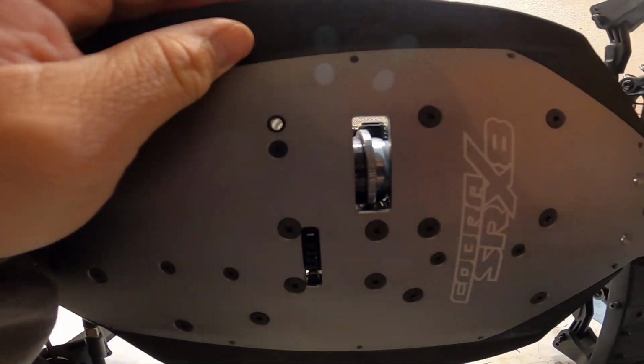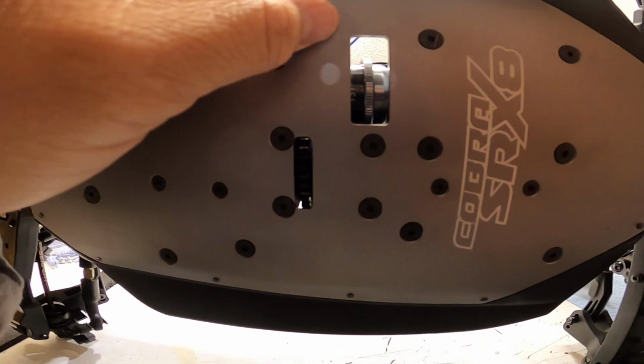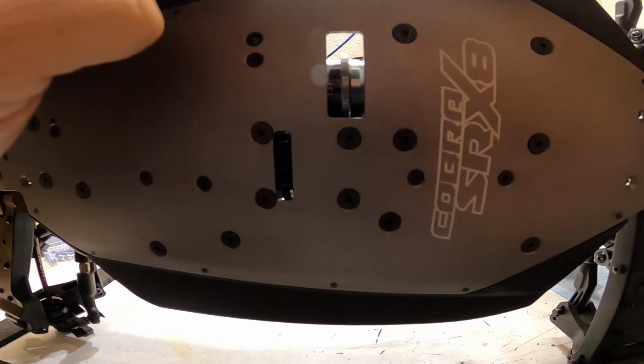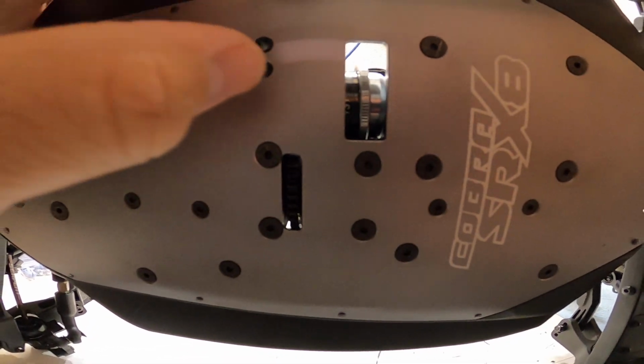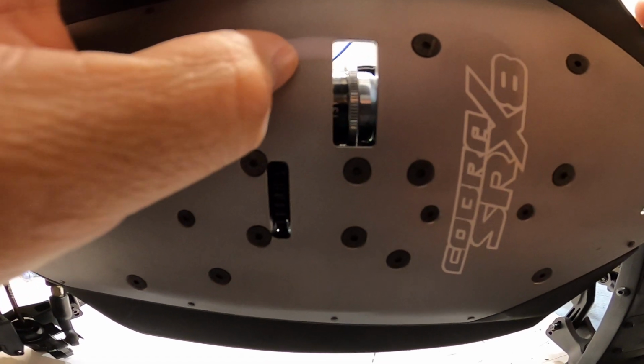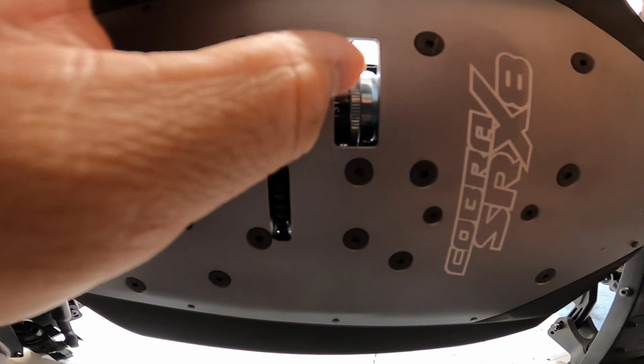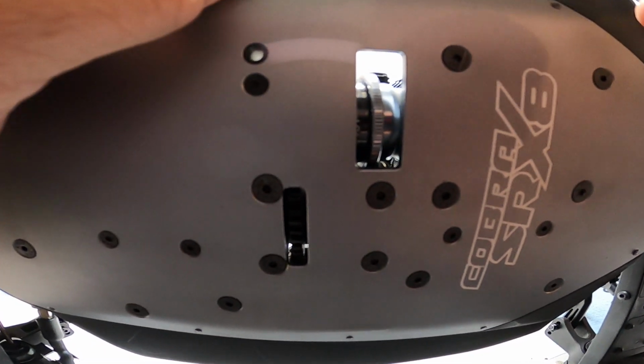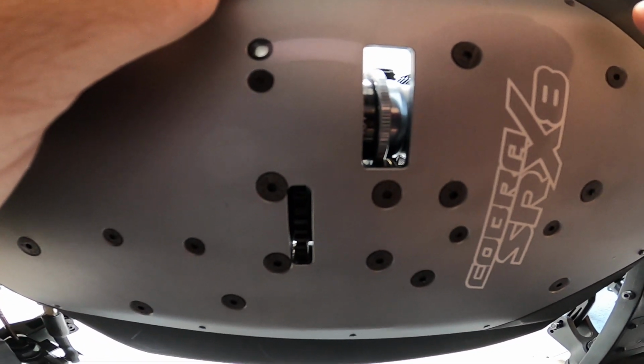The next thing you want to do is make sure that your flywheel is centered as close as you can from forward to aft, so that your starter box will properly engage it. The only real way to adjust your flywheel is by a shim underneath the collet before you assemble the entire assembly.